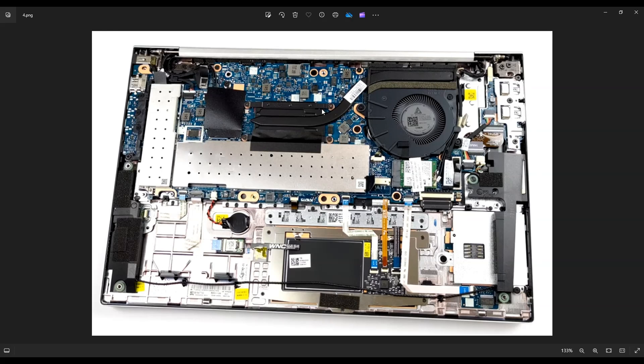Also with an overheating issue, if you're here to reapply thermal paste, you would unscrew these four screws over your CPU to release that heat sink. If you are here to reapply thermal paste, there'll be a video link below in the description and up top — that'll be a quick tutorial on how to apply thermal paste after cleaning the old stuff off, which you definitely want to do.